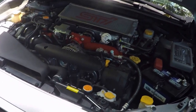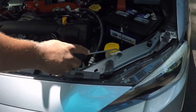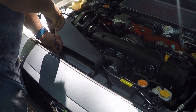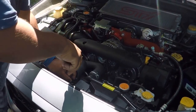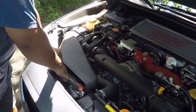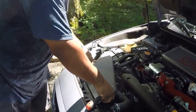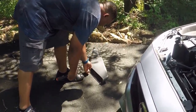The first thing we need to do is get this air intake plenum out of the way, and we're going to take this windshield washer filler out of the way too. Start with the plenum. I already prepped these screws and fasteners in advance because I had never taken these off before and I didn't want to struggle with them. Just turn the flathead part 90 degrees and pop them right out. Then the intake plenum moves right out of the way. Set this aside.